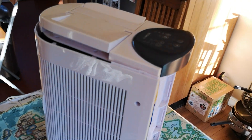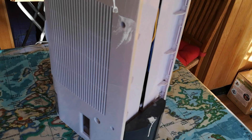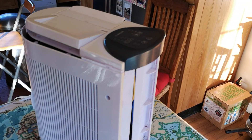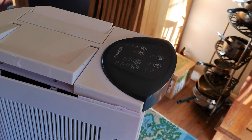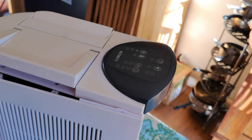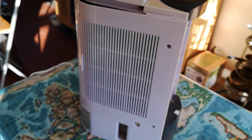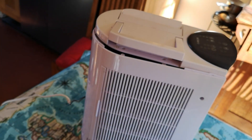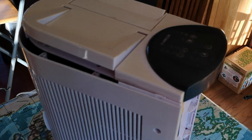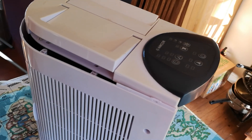What you use instead in a cold situation - a cold damp shed, cellar, or somewhere - is a desiccant dehumidifier. They work by having a desiccant chemical on a wheel, turning around soaking up moisture from air blown through it, then heated up and dried out. This one I bought for £2.90 on eBay because it was faulty, and I thought I'd repair it and use it in my shed. I've just repaired it, so I thought it might be interesting to look inside.